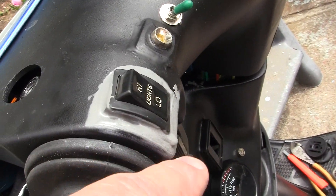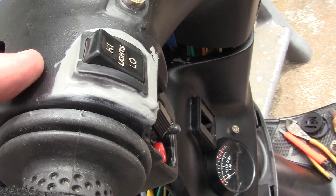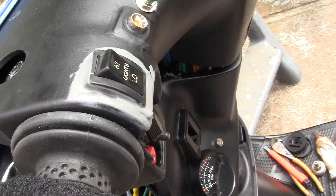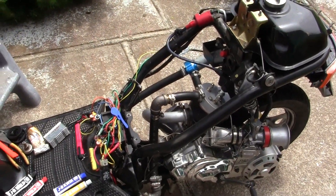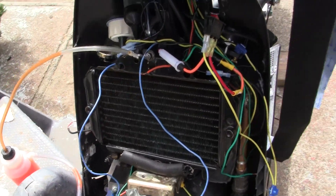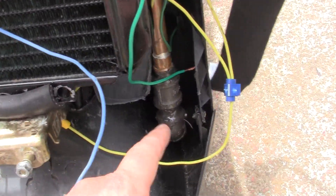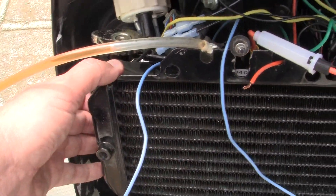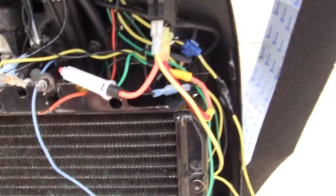So I'm going to take a little grinder and I'll take that off right there, then I'll fill this hole up with the Quick Weld, put a little bit of 400 grit sandpaper all around here, and then dab on some bumper black. It'll be in great shape. Just last night I came up with this brilliant idea. Since this radiator is held in place by this bottom rubber piece, it's also held in place by the side pipes right here, and I need to either pull up on the radiator or push down on one side to get the top piece to fit — the fairing.